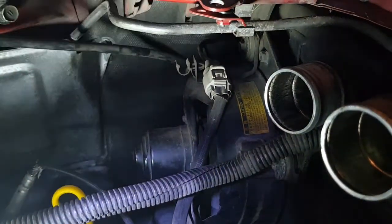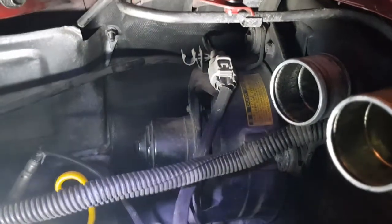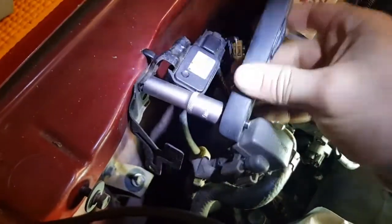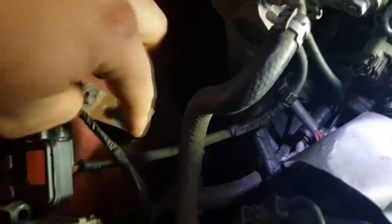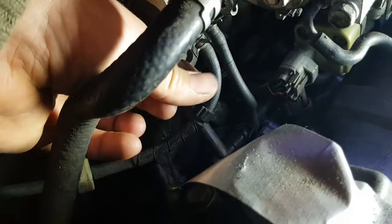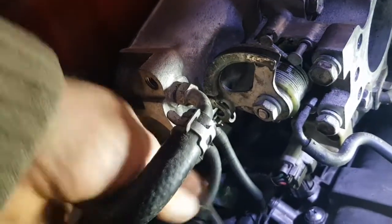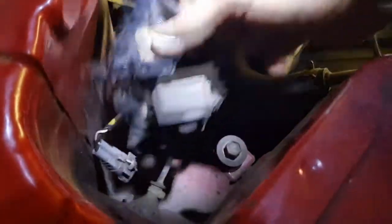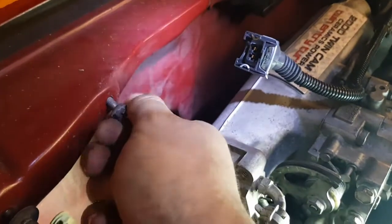Place all the covers back on with the screws so you don't lose them. The throttle cable unclips from there — just put to one side. Undo the diagnostic and boost control bracket, remove it from that turbo pressure sensor. Remove the vacuum line here from the intake like that, move that down out of the way. Place the bolt back in the hole so you don't mislay it.